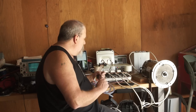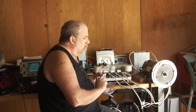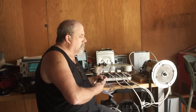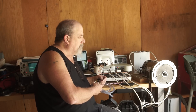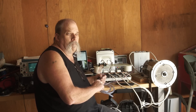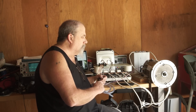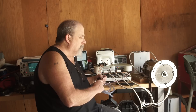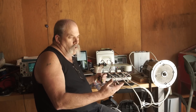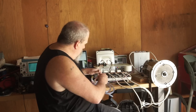One of the things it's doing — when I just turn the throttle on all the way and crank it up — it's really slow to crank up and get going up to speed. Then I can stop it and it'll stop. At a certain point it just freewheels and there's no regen up to a certain point, and then beyond that it'll stop up to a certain RPM. It's no load, so I can't expect a whole lot. I just needed to get to this point where I have throttle control.